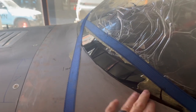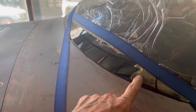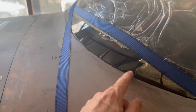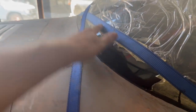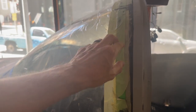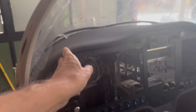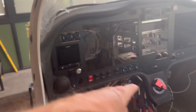We've got 630 hours on the clock — the windscreen's glued in. I've taken a lot of the tape off from around the edges; I don't like leaving it because it dries out and then you can't get it off, particularly on the inside. Because it's so thick and we've got a seven-day drying time, I'm going to leave the bottom straps on for a week. This one I'll leave for 24 to 48 hours then pull that tape off inside. Everything's cleaned up inside — the glare shield and panel are in — so hopefully none of that will have to come out again.